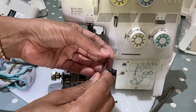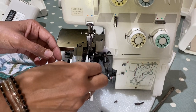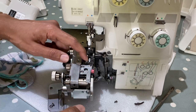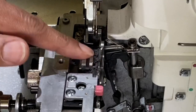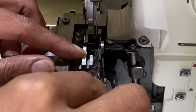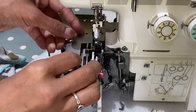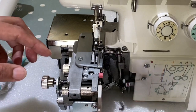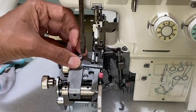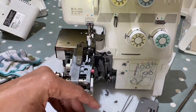And you can see it's almost formed the shape there, but because it's so squeezed, you get oily fingers from that. You need to make sure you take your needle plate off regularly, because can you see, if you don't remove that lint, how can the feed dogs do their job, especially if you're building up a big thick felt from the lint that's been placed in there. So you've got to make sure you lift off your needle plate, and it really isn't very difficult. Usually, on these Janome machines, it literally is just take the foot off and remove this one screw, and it's easy to get to because it comes directly in front like that with a screwdriver. So you just need to remove your foot, and you can get access to that.